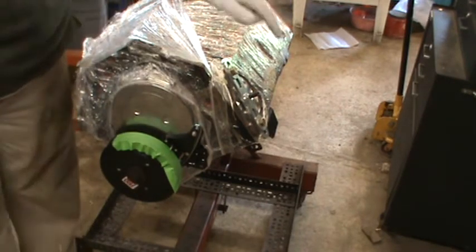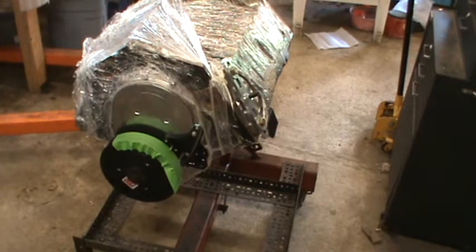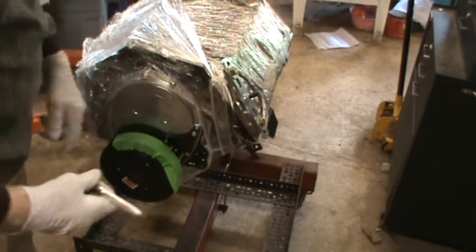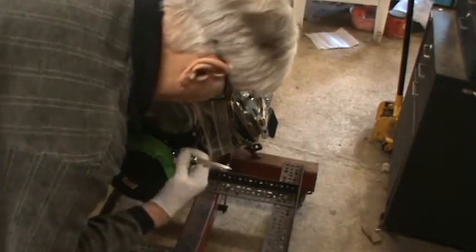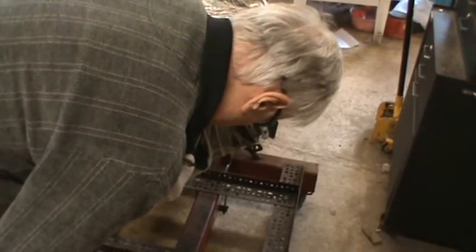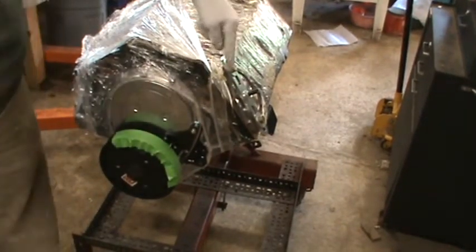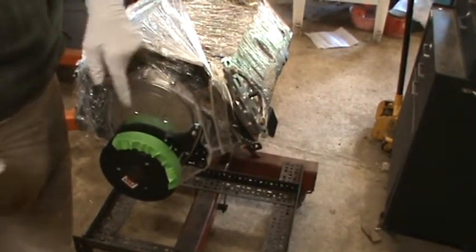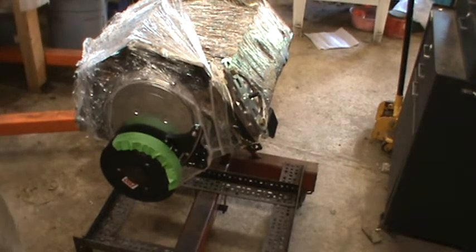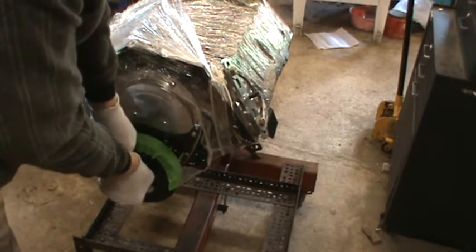So now there's room between the piston and the stop. We're going to turn the engine over until you feel it stop — it's touching. I've put some tape on the harmonic balancer. Since I tighten this point it's not going to move, so I'm going to make a mark right at that pointer. That is going in, turning the crank from the front in the clockwise direction. Now I'm going to rotate it the other way until it stops.